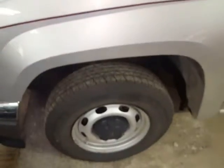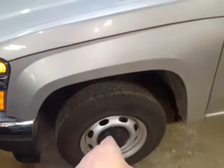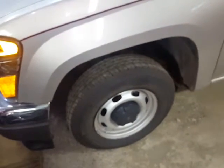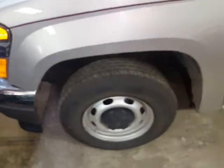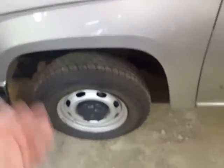When I had this up in the air, one wheel looked like it was tilted a little bit more than the other — so that's a wheel bearing. I ordered two on eBay for 98 dollars with a ten-year warranty, so that should be cool. I'll do the upper and lower ball joints and the wheel bearings all at one shot — shouldn't take long.